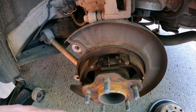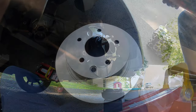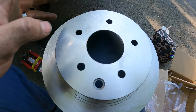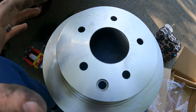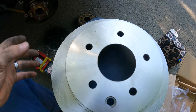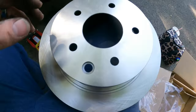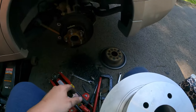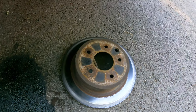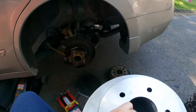We'll clean all this up and then start putting the new stuff on. You need to get some brake clean, spray it on the new rotor, and wipe it down really well, because it comes with a manufacturer coating so it doesn't rust on the shelf. If you put that on with your brakes, you won't get good enough friction — it'll wear things out faster. Brake clean at O'Reilly is like four bucks, so it's definitely worth it. Just for comparison, here's the old nasty worn-out pad versus the new one — nice and thick.